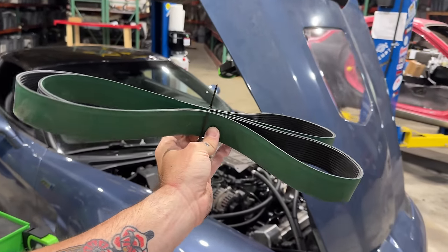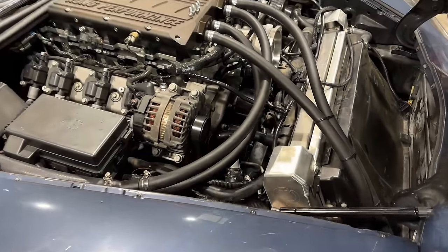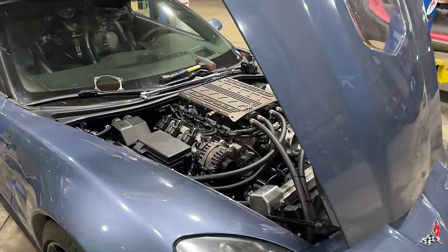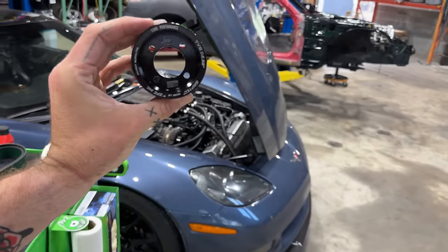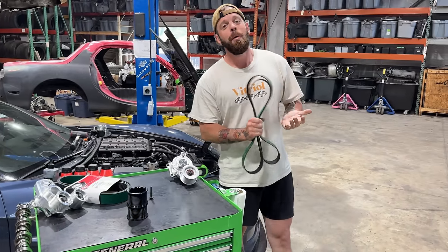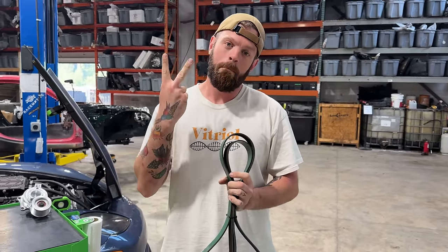The other method of increasing how fast we're turning this belt — therefore blower speed, therefore boost — is to increase the size of the lower pulley. So remember this: for more boost on a supercharged car, bigger lower pulley, smaller upper pulley. When I first got into the supercharged stuff, I of course thought, let's stick as small a pulley as possible in there, make a ton of boost, make a ton of power. Unfortunately, that's not quite how it works. The two byproducts of increasing blower speed and downsizing that pulley — heat and belt slip — neither of which are conducive to a healthy engine or making power.